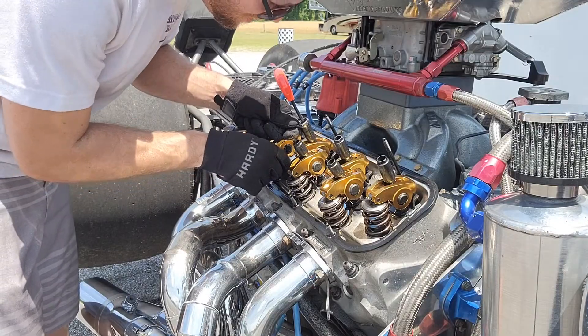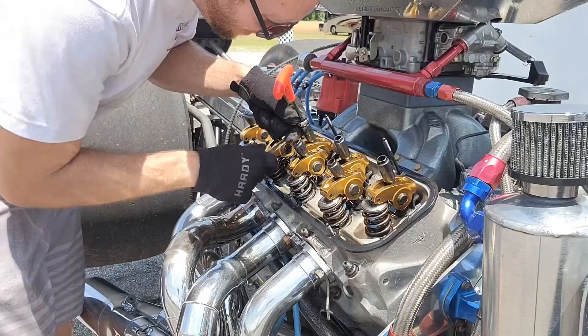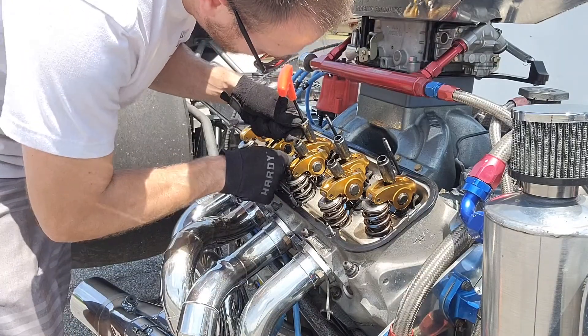Another thing — there's a performance aspect to this as well. That's where my phone cut off; it was so hot that it stopped recording, and I didn't know until I was done and found a message saying the temperature was too hot. To finish my thought: if the valve lash is running a bit loose, it's not following the cam as tight as it could be, meaning you're not getting all of your cam grind out of it. You can be robbing yourself of a little bit of that lift and duration since it's not following the cam as tight.